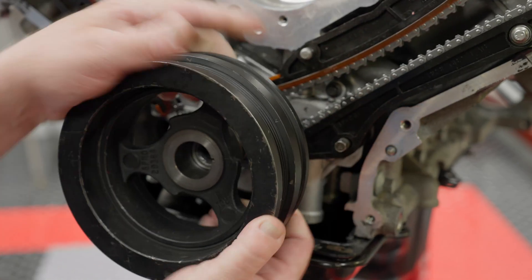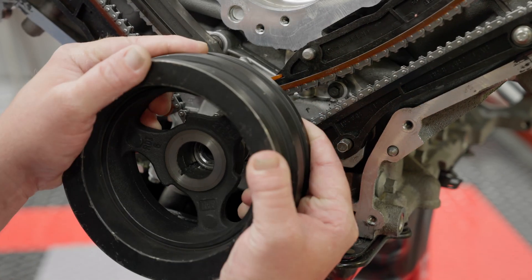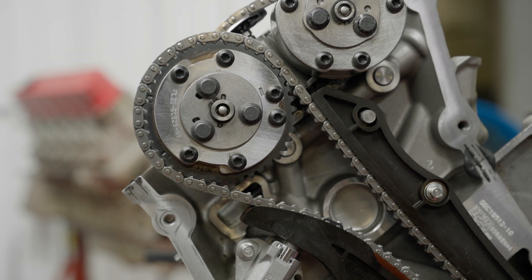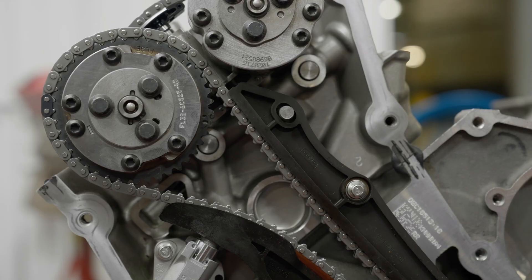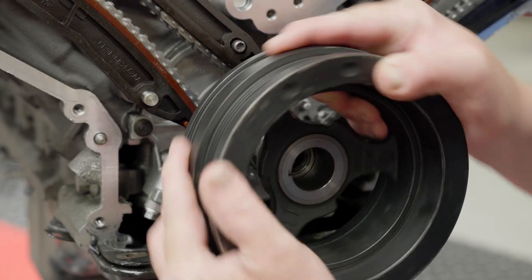Once the components are visible, rotate the engine until the crankshaft key is at the 730 position, and confirm the R timing mark on the right-hand exhaust phaser is up. If your crank key is at 730 and the exhaust mark is not up, rotate the crankshaft one full revolution and check again. This is the ideal position to start disassembly. Don't worry about the left-hand bank or which stroke the engine is on. This procedure ensures you're in the correct position to begin service.